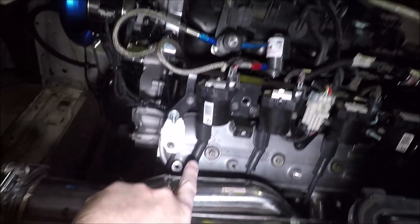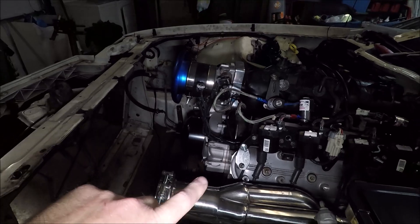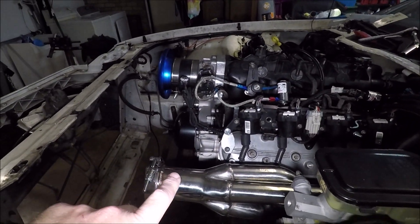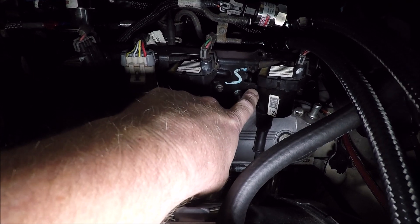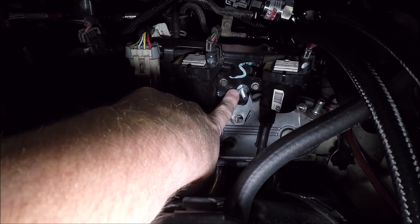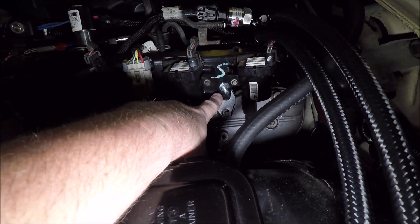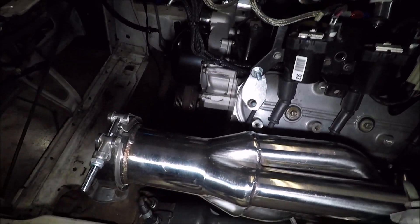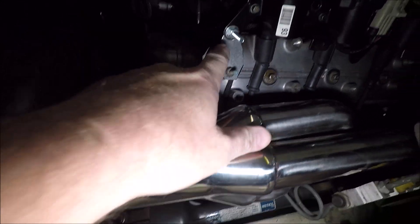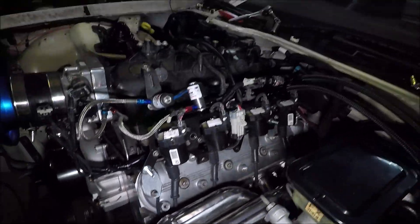All I did was plug all the wires in and made these little spacers. I'm going to insert a picture of the spacers I made. The spacers are a diamond shape because you've got your coil mounting bolts that mount the coils to the factory bracket, and they need to go in between those bolts back here — that's why they're shaped like diamonds. I could give you the measurements between the holes, and it's not a straight line as you can see; the bracket kind of bends up a little bit, and it's that way on both sides.